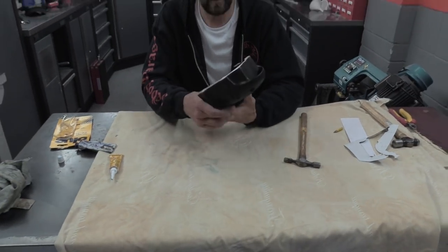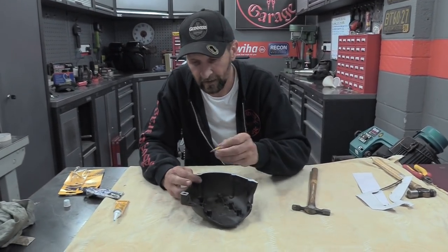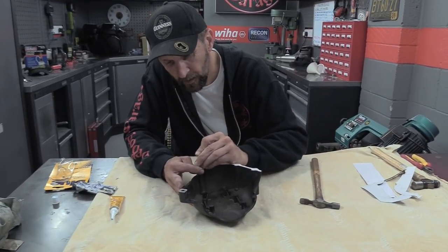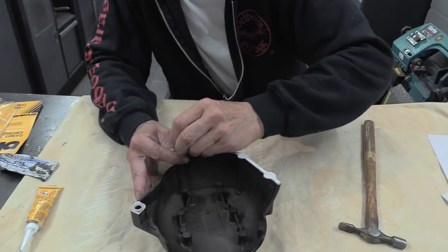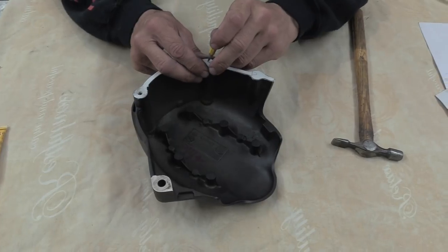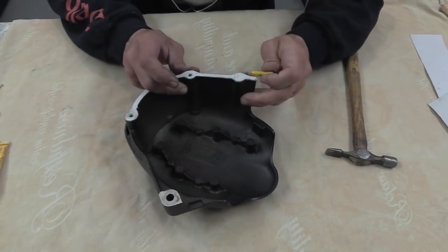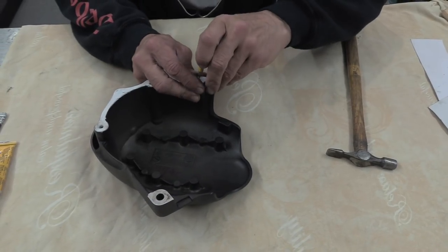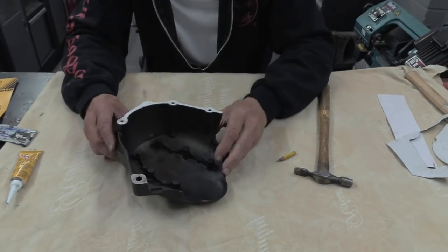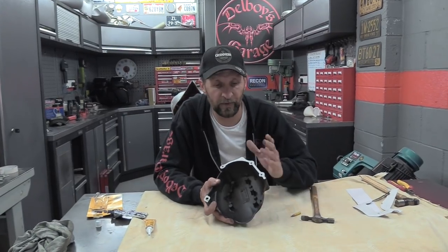Okay, finally, we've obviously got bolt holes to consider. So pencil, and just in the center of the hole, make a little hole like that. Same as that one, right in the middle, and the same as that one. There we are. So what we've achieved there is an absolutely perfect card gasket that will seal that every time if it was a sealing joint.